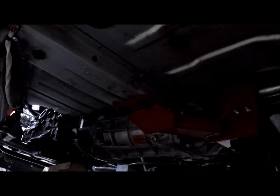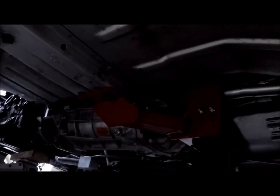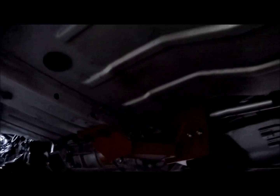But I'm actually going to adjust the spacing of that center bracket, the part that's cut clear right now, just a little bit. And it'll end up lining back up with both sides, so it'll only end up getting offset just about 1/4 of an inch. And that'll get plated back in and fish plates for reinforcement. So very nice.